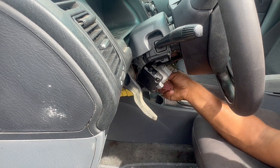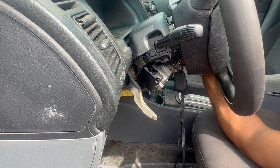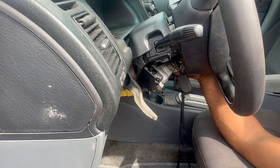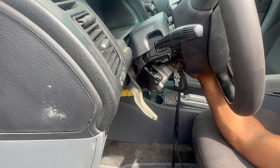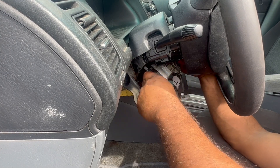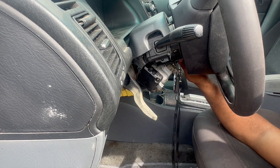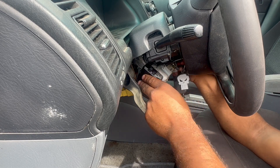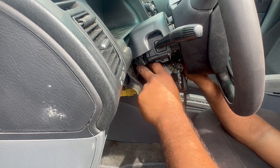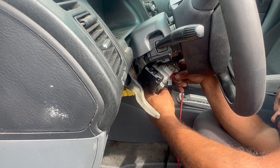Okay, I think it's better. I'm going to hook this in there and crank it. See, now it does better — it comes right on. It just takes a little while sometimes to crank. But that's the thing — it's not working right consistently. Sometimes it worked, sometimes not. This time it didn't work, so we're going to need to replace this part because it's not making good contact. If you hook the power in here on the black-white wire again it won't activate reliably.